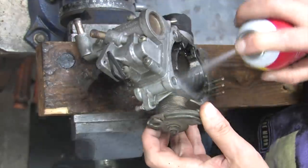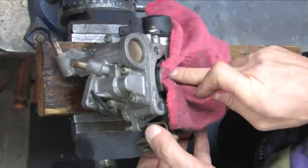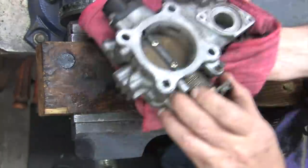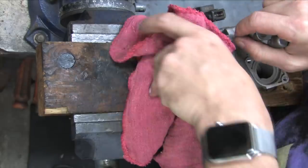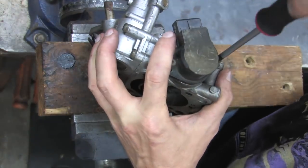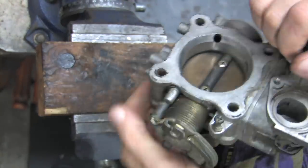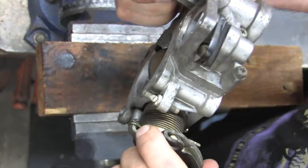Everything works the same, but the throttle plate is physically smaller, and it has a different throttle position sensor because the idle switch is integrated into it. It also has three parallel vacuum ports on top. The cleaning process is exactly the same. The throttle position mount is exactly the same. The linkage under it is exactly the same.